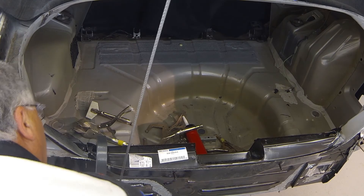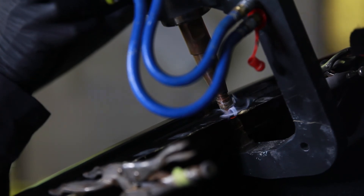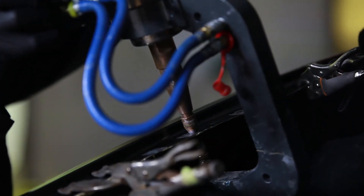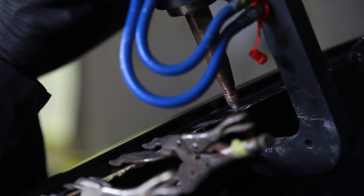A lot of spot welders now have counterbalancers to help manage the cable and make it accessible for the technician. Regarding the high electromagnetic waves — for safety, if you are welding on a car, you want to disconnect the negative post of the battery. If you have a computer within 15 inches of where you're welding, you don't want to subject it to the high amperage being transferred through the metal. As an estimator or technician, you're going to want to charge to remove that computer, and you may have to reset and scan it afterward. There are a lot of other ramifications.